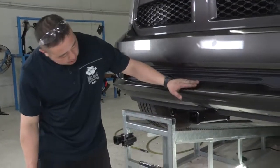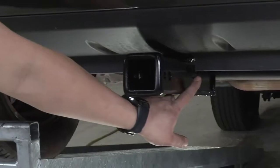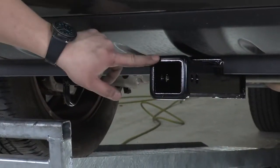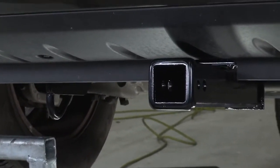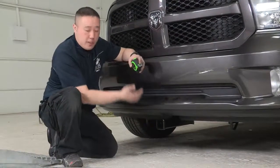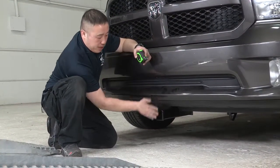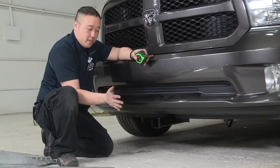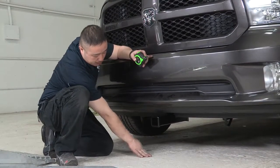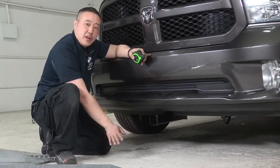This is what it looks like completed. The cross tube that goes across the vehicle is completely hidden behind the fascia here. The notch out that we did was pretty much right on. We've got a two-inch receiver opening here for your use, and it's also got two tie-down points — one on each side of the vehicle. From the hole where you put your pin in to the front bumper is going to be 6 inches — that way, if you have any accessories with a post that goes up, you'll know how much space you'll need. From the ground to the top of the receiver tube is going to be a total of 10 inches, in case you need a rise or a drop for any accessories or things that you're pushing into storage.